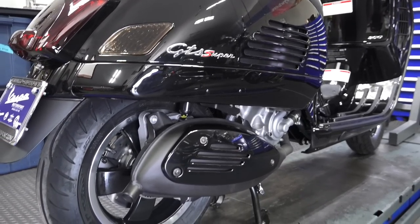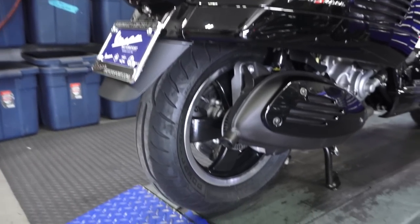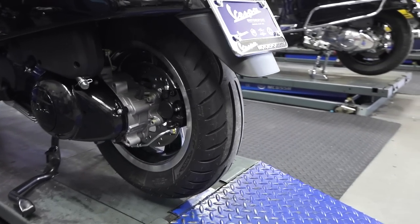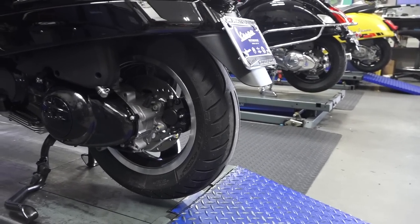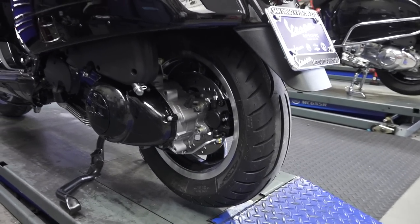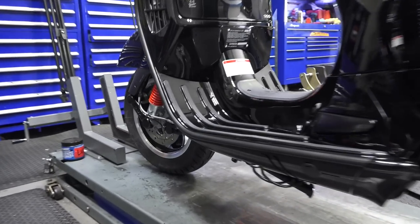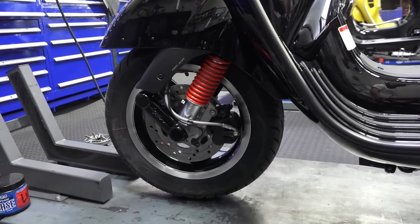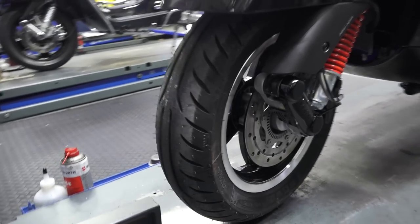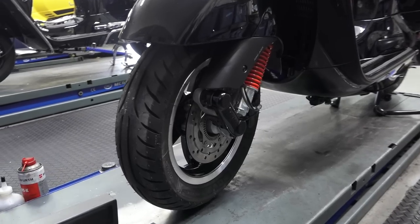The customer opted to go with different tires — you can see they're one size up. It's a 140/70-12 in the rear, so you get a slight overdrive, technically a little higher top speed, at the expense of a little more drag on the engine and ever so slightly slower off the line. In the front they went one size up to a 130/70-12. No problems installing those tires — they don't rub on the fenders. It's a simple upgrade considering you're just using the stock rims.